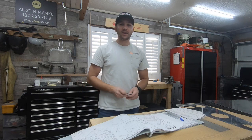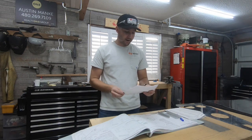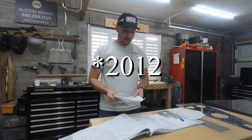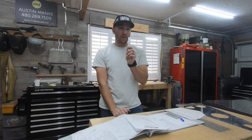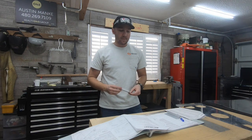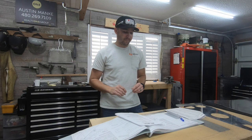That was not the case. When I spoke with Vans builder support, he confirmed this is a still-active service bulletin, effective for all Vans RV-10 aircraft kits purchased after April 2012. I never received this bulletin — it didn't come with any of my documentation. The risk of not acting on it is that after bolting everything together, the elevator horn could get wedged or lodged against this part.